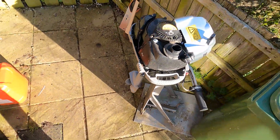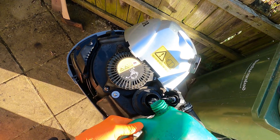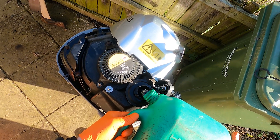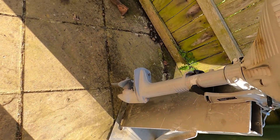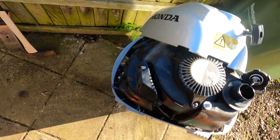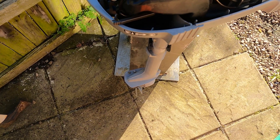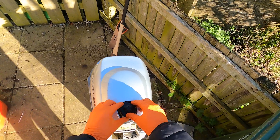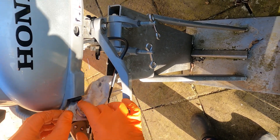Now we'll put some fresh fuel in and just check for leaks. The tank's not particularly big, so I'm not too worried if we lose a bit. We'll drain it — it's really easy. That's about half full. Fuel's in the off position — we'll put it to the on position, let the bowl fill up, give it five minutes and just see if there's any leaks or drips. It'll be very evident if there is. Refit the lid secured at the front, fuel cap back on, vent open. We'll fit a makeshift pull cord on there — put some oil grips on, put a cloth to protect it, pull it out to see the gap.